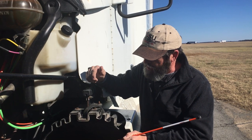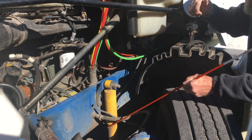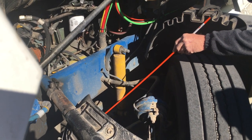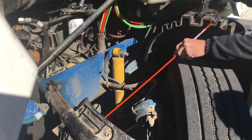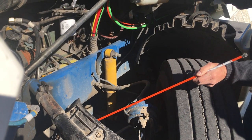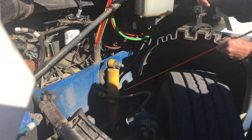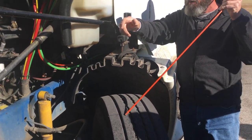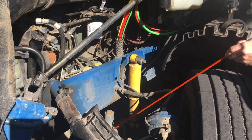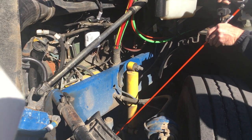Suspension first. Shock is right here — securely mounted top and bottom, bolts and nuts tight and secure. If there was fluid leaking between the top and the bottom of the shock, that would indicate a bad shock. Leaf springs — not cracked or broke, not shifted, not missing. They come into my spring hanger or spring mount, front and rear — not cracked or broke, securely mounted to the frame of the truck, bolts and nuts tight and secure. The U-bolts holding the springs to the axle — the nuts underneath are tight and secure, not cracked or broke. Suspension's done.